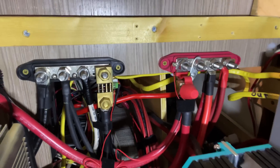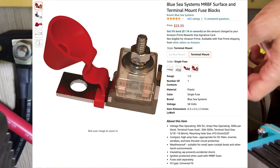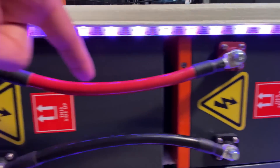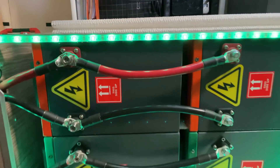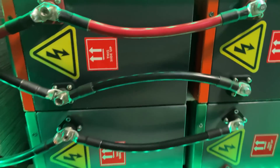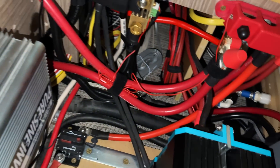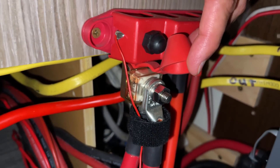I've got all my negatives here — this goes to my Renogy battery monitor and these things work really well. I changed out all of my breakers for these inline fuses — these are Blue Sea and they're awesome. This is the power coming in from the batteries. The batteries are daisy chained, which I don't love and would like to rewire, but I'm limited on space. They come in through the wall and up to the main fuse over here. I never draw more than about 180 amps — that's my absolute max.